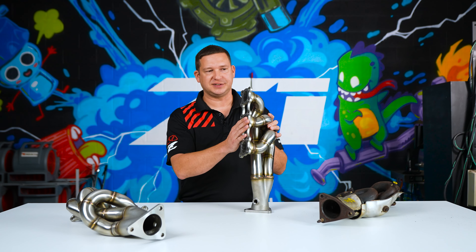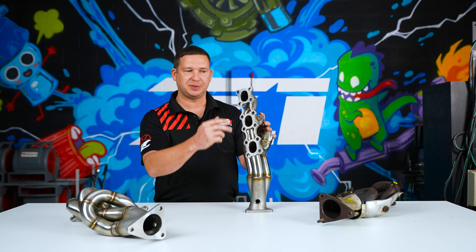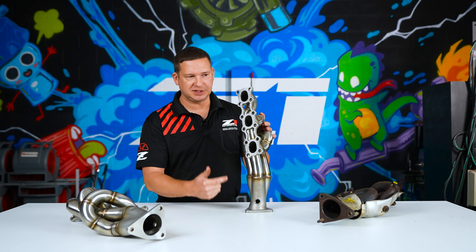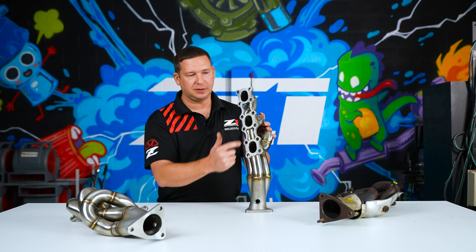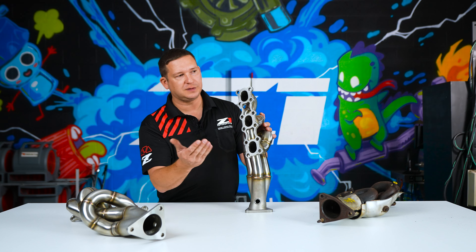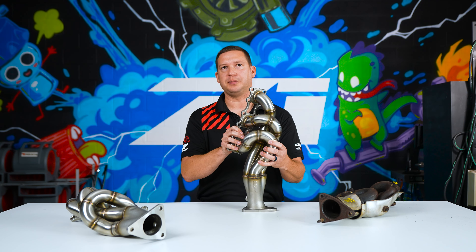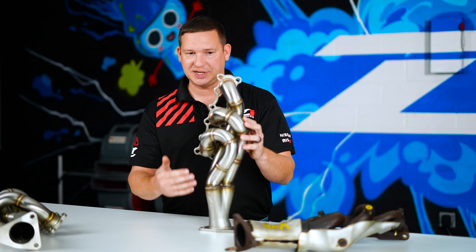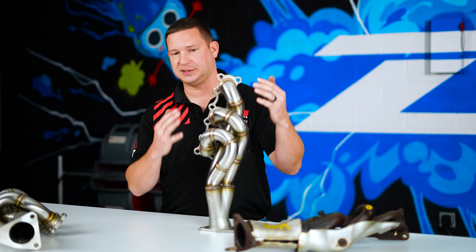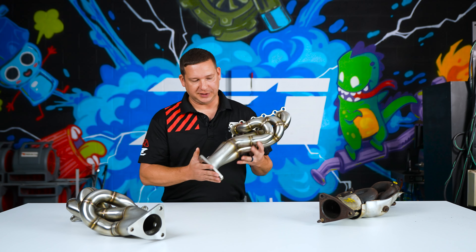The header flange is 10mm thick. We've added holes around each port so that depending on your year, some of the positions of studs or nuts were in different places and it made it difficult to do the install. So we've made that accommodation to get that part on, cut some weight out of the body of that part. We've integrated the transition from a more rectangular port to the round tube shape without having to have a fabricator work on shaping the pipe. Our team tooled up to get some specific mandrel dies made in the shapes we needed to get this construction possible, and we beefed up the flange on the outlet side.